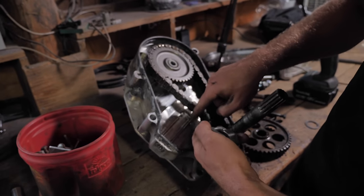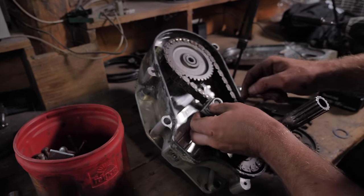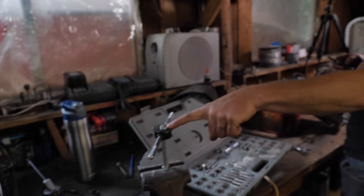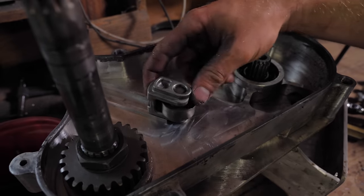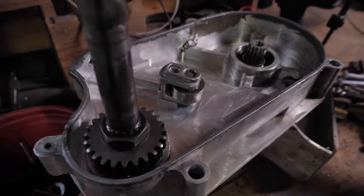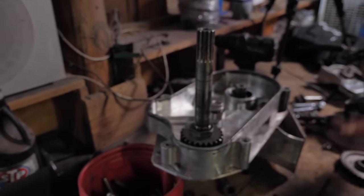All we really have to do is cut out a little bit more of a notch there for this to slide farther, and then get a longer bolt — which we don't have, so we're going to thread this one. Got room to slide it now, get the chain tight. We'll get all the metal filings out of there and put it back together.